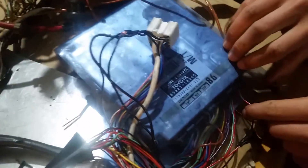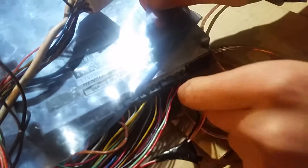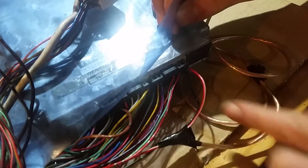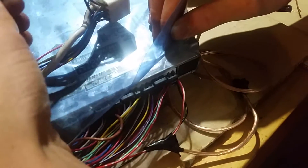You also want to put 12 volts on your ECU, which goes into these two — or actually only into the top one. The bottom one gets its 12 volt supply straight from here. The top one is always connected to the battery. This one is connected to the battery via the key switch, and is one of these three up here.